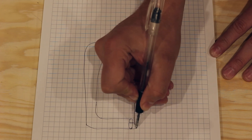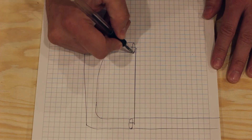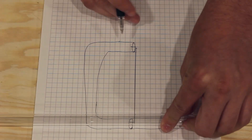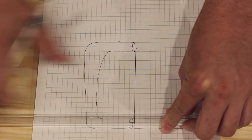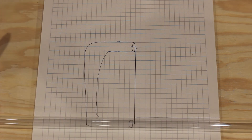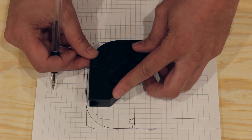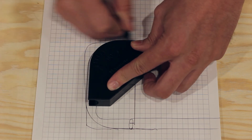This tube is going to extend all the way across to your radiator. At this point, you're not actually going to cut the tubes — you're going to take your tube and bend it at each 90-degree point, and then cut a little bit off each end to get it to fit into your fittings. Never cut your tube until you're done with your bends. Do all your bends, then cut, so you never end up with a tube that's too short. Using a mandrel tool, I can identify how I want it to bend and locate the center of where the bend needs to be.